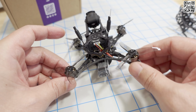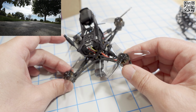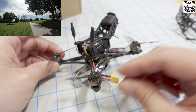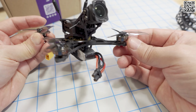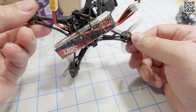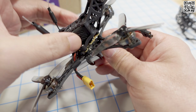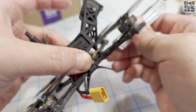Trust me, I've seen people do that. So what you're gonna wanna do is, when you first arm, you're gonna wanna right it so it's level, and then throttle up to take off. For those of you first time flyers, you might have difficulty with that. So maybe some other tray or battery solution might be in order for people that have difficulty with that. But I just want to bring that awareness to you in case you're wondering why it's difficult to take off.